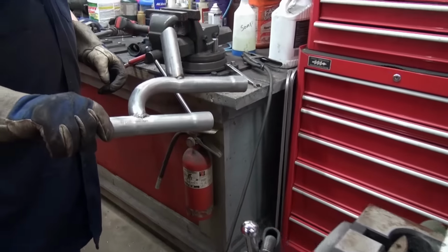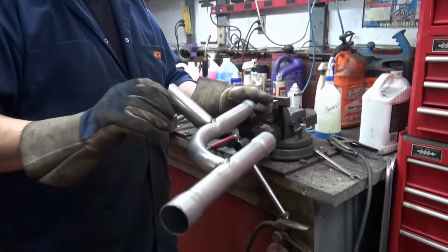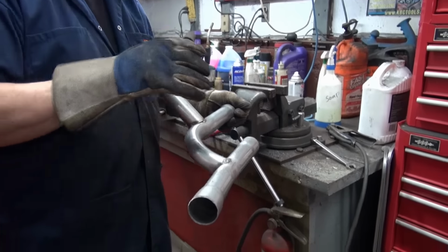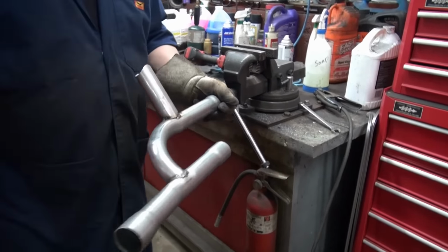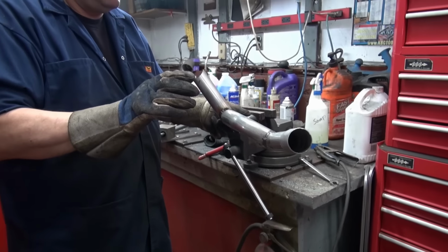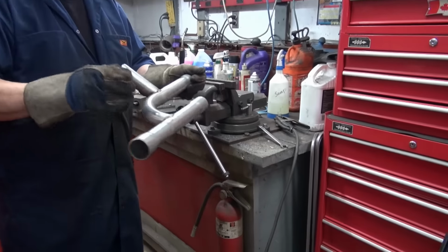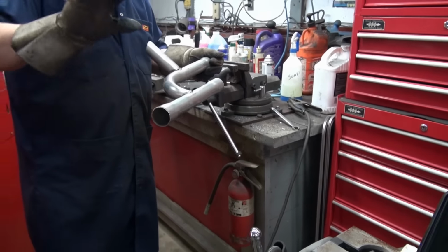What a contraption so far, eh? Gee, well, that looks good, though. Yeah, well, what I'm doing is I'm putting it on, marking where it's got to go, drilling them out, then using the rasp, carbide rasp, and I'm getting the holes right round. Then I put it on, and I just tack it, I pull it off the bike, come over and weld each piece. And I'm going to do that now